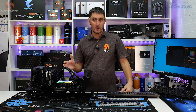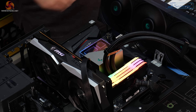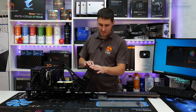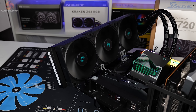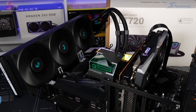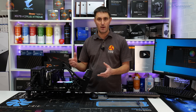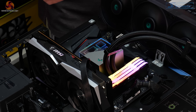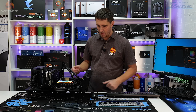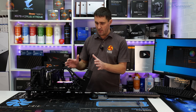The installation is a really quick process — it probably took me 10 minutes or even less to install the whole cooler and get the wiring connected to the motherboard. Installation is a little quicker on an open test bench due to easier access. Even inside a case, I wouldn't expect it to take longer than 10 or 15 minutes for someone who is technically minded. The reason it's so quick is because it retains the stock back plate, there are no proprietary wiring connections, and no additional RGB hubs to install — which saves time with cable management. For me, that's a win for Deepcool.